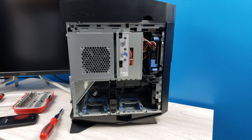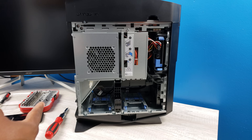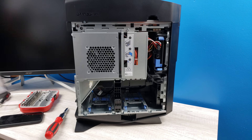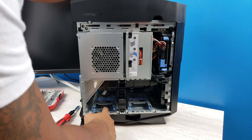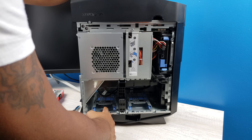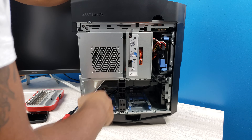One of the things we've done already is we disabled the Intel Optane SSD drive in the Intel Rapid Storage software. Now we're going to take that out. There's only one M.2 slot on the motherboard, so we're going to remove the Intel Optane memory and replace it with the 970 EVO. Down here there are two bays for 2.5-inch drives I'll use later for scratch disc and video gaming.